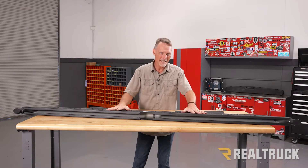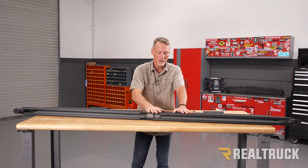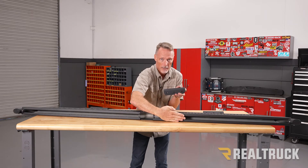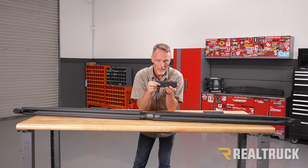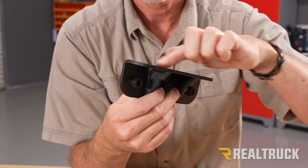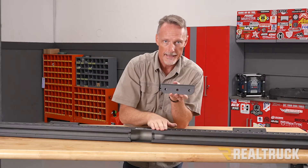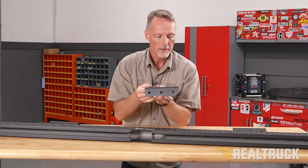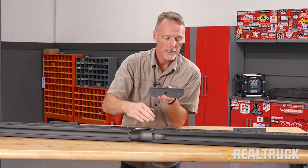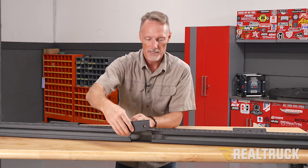Here is your D6 running board. I've got it positioned so if you're underneath the truck, this is the angle you're looking at — I want you to see how it mounts to your brackets. The brackets have a 90-degree bend that mounts to these locations. This is your welded nut plate; it has a shelf at the top and a face that goes toward your bracket. The nut plate gets inside the board through this opening. Because we have two brackets toward the front and one toward the back, we put two welded nut plates into the front side and one on the back side.